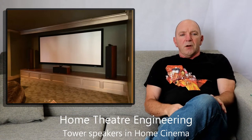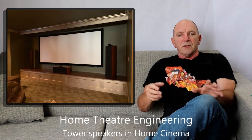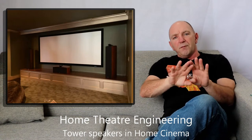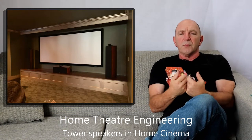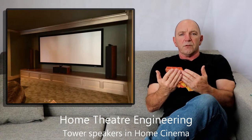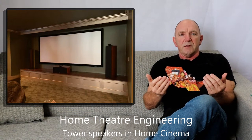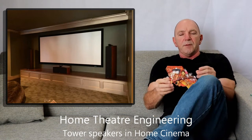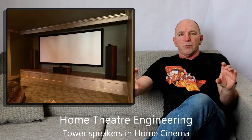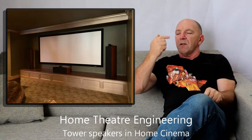We may struggle to lift the centre up, especially if we've got a television or a non-acoustically transparent screen. If your speaker is in a cabinet, please bring it right to the front, and if you can, fill the cabinet with acoustic absorbing material — because sound propagated by that speaker resonates and echoes around the inside of the box, comes out, and mixes with and distorts the direct sound, making it much harder to hear. Bring it right to the edge of the cabinet as far as you can and pad it up. If the speaker is way down at your feet and you can't lift it, build a wedge out of wood, rubber, or foam and tilt the speaker up so it's aimed at the predominant listening positions.